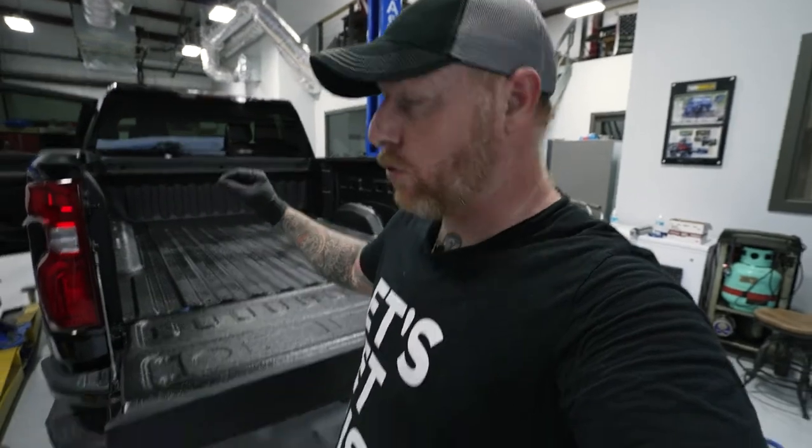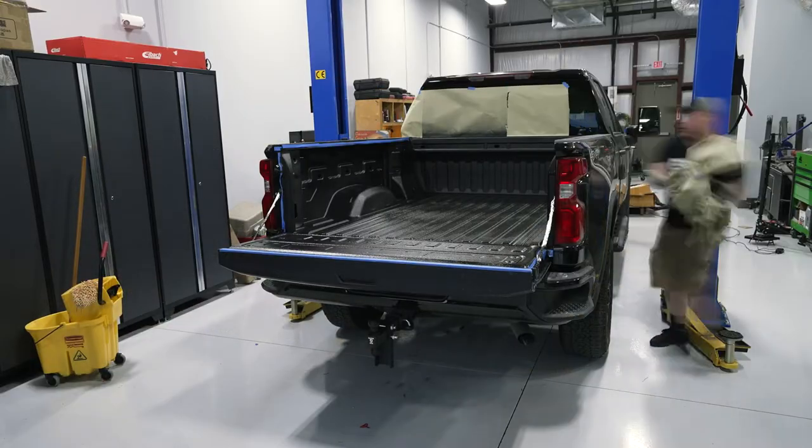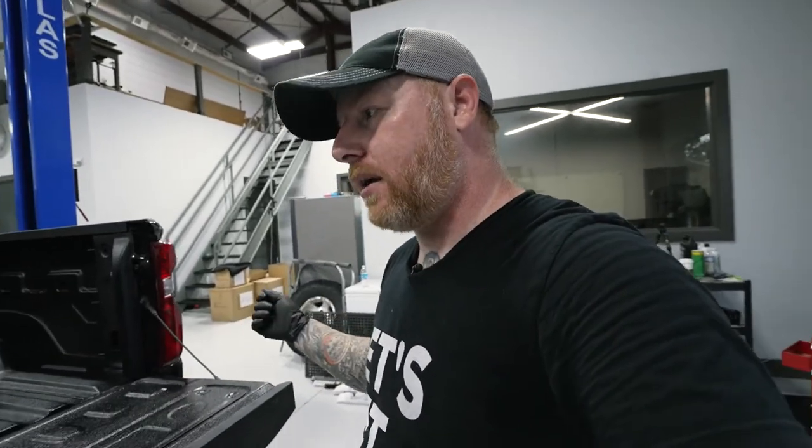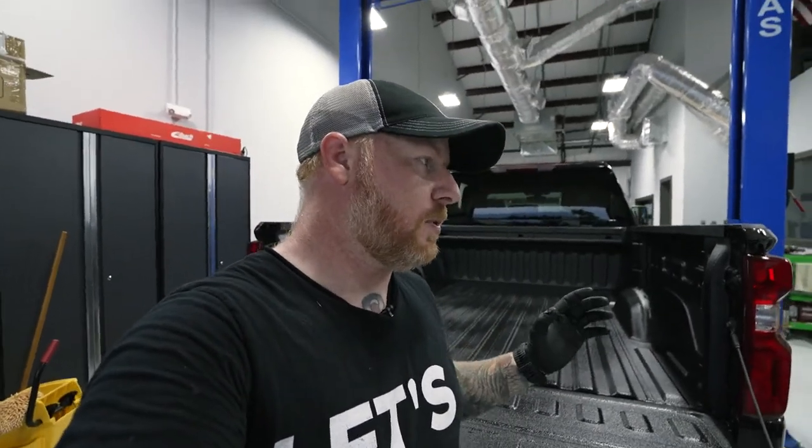This turned out great. There are still a few things left once it cures the rest of the way - put the plastic plugs and stuff back in. One thing to note before you go unmasking: see how tacky this is. I usually wait about 20-30 minutes and then start unmasking things. That way the tape doesn't end up drying and curing to the bed liner and become a pain. So unmask it before it gets too dry, but don't unmask it too soon - give it 20-30 minutes. I hope you guys learned something from this - tag me in your projects on Instagram. I'll leave links in the description to all the stuff I used. Like this video if you liked it, subscribe if you aren't already, and I'll see you guys in the next video. Peace.